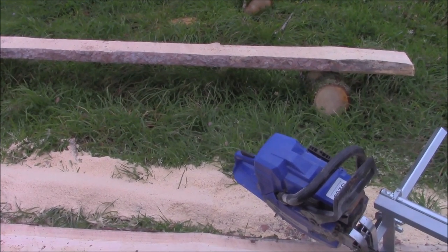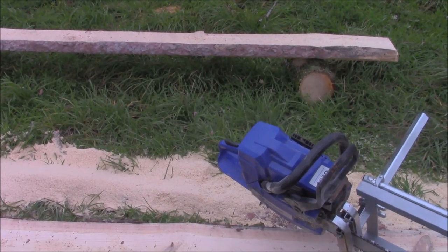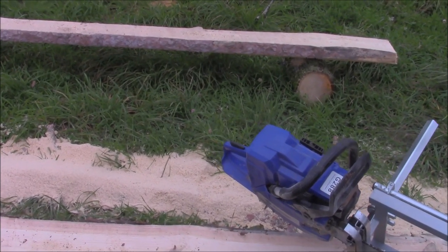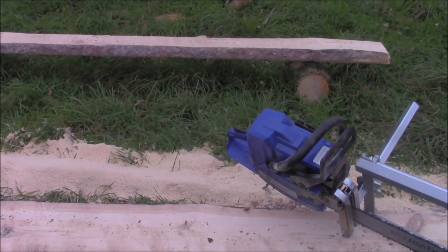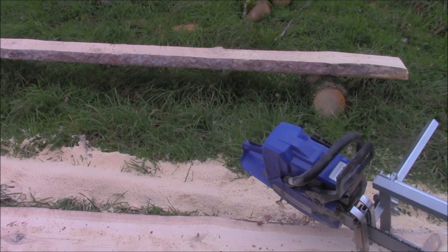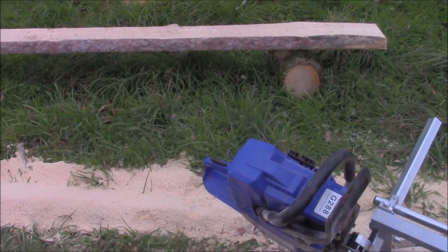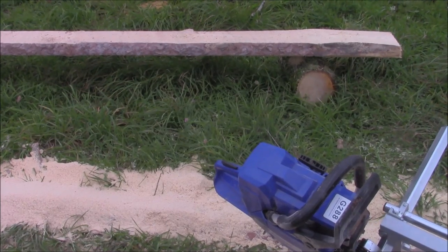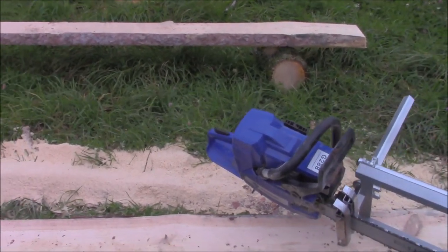You have to have the cooling system have a larger capability of removing the heat than the saw burning gas and air has the ability to generate heat. It has to be somewhere around equilibrium for a normal work saw. And on a continuous situation like milling, the cooling system has to be able to keep up with however much power is being generated, and how much heat is generated as a result. You know, there's an efficiency here. A lot of the saw mods are about cutting for 10, 20 seconds at a time. And a work saw is about doing that over a period of time and not having so much heat get into the system where it comes apart.